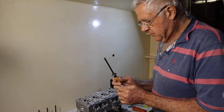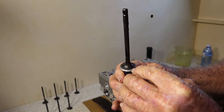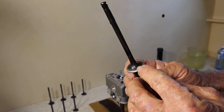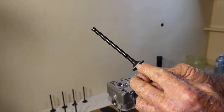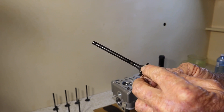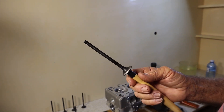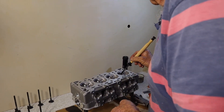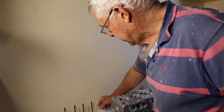With older cars that had burnt valves, a lot of times they'd have a track burnt right through — just an area that was burnt through. If they were badly burnt, you'd have to throw the valve away or get it faced off in a machine, and there's a limit to how far you can go. For performance cars, thicker exhaust valves flow better and thinner intake valves flow better.